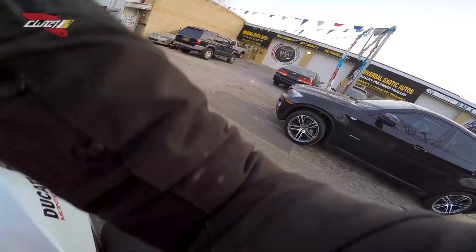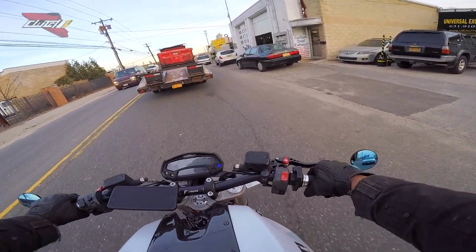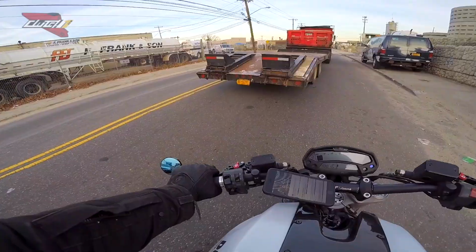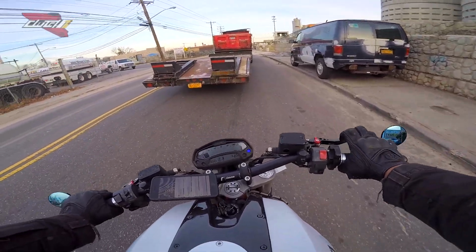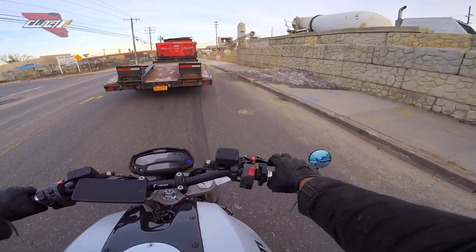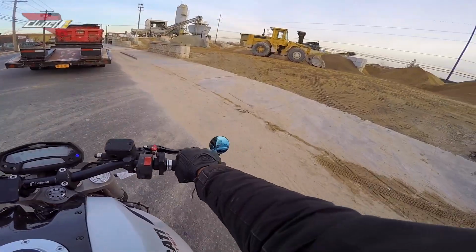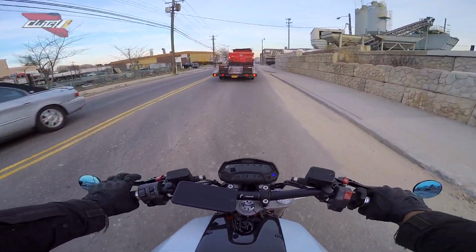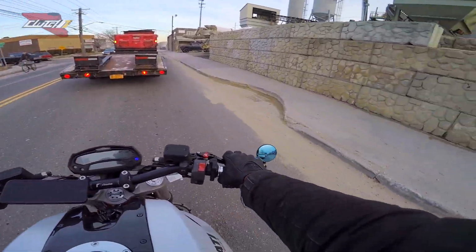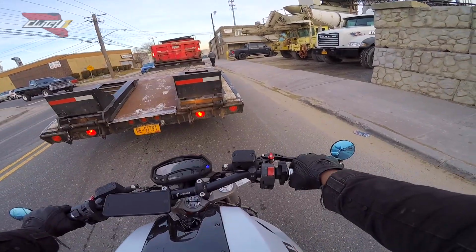I'm telling you, I feel like the tougher the bike is to ride, the better rider you become over time, because you have a very good understanding of what to do and what not to do. So if you're a Ducati rider in any city, you might end up swapping out your clutch plate a little faster than usual, only because you're constantly working it. That's probably why you might see people's clutches slipping over time, because you're working the clutch so much to make the bike so smooth.